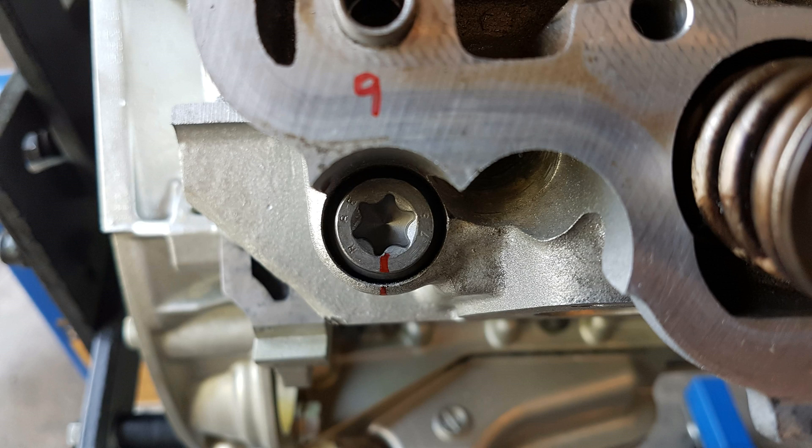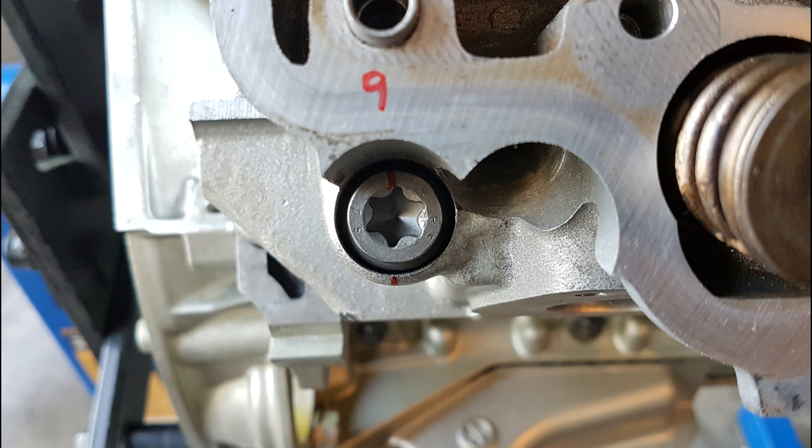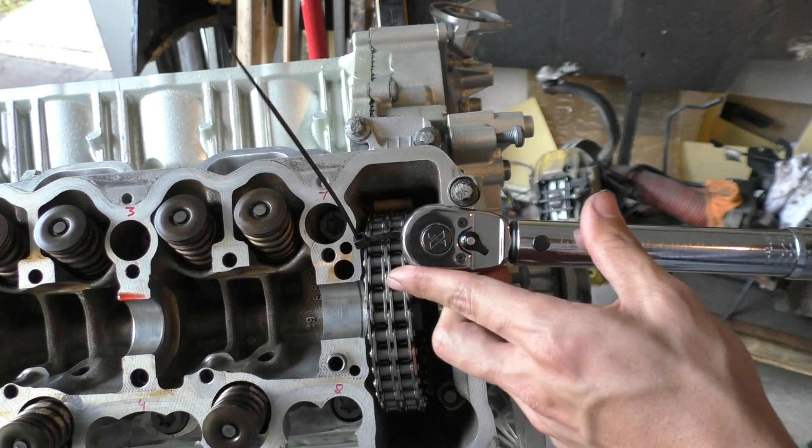To keep track of how much I'm turning the bolts, after the second stage I like to mark the bolts so that when I turn them 90 degrees and then 90 degrees again I can actually see how much I've turned them. It's important to keep track because if you accidentally turn the bolt one extra 90 degrees you can over-stretch it.